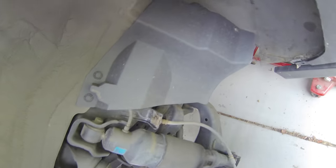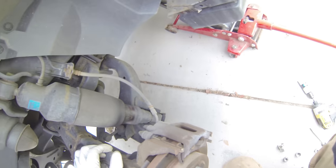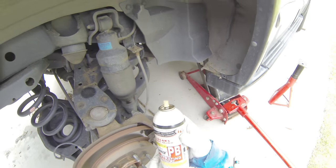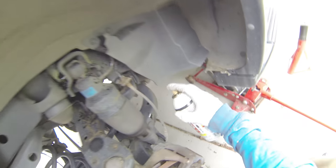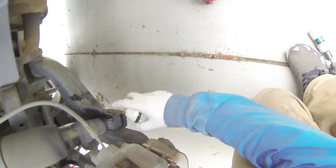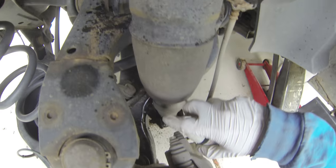So we're gonna take this off. Looks like it's one bolt right up here that's threaded in, which is nice — you don't even need a nut. I'm gonna soak this bolt in PB Blaster and this one too, and then this air line. You can use WD-40, but PB Blaster is really good — it's a penetrant for old rusty bolts. Soak it on the threads. If it's bad you have to give it some time, like 10 to 15 minutes. If it's real bad you might need heat.